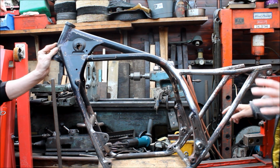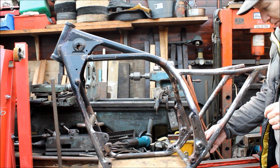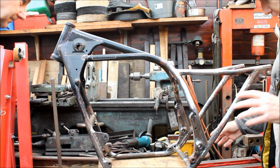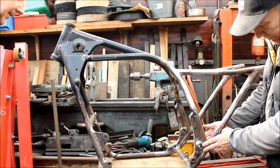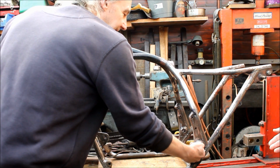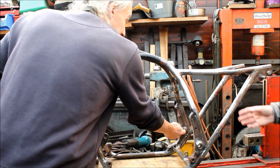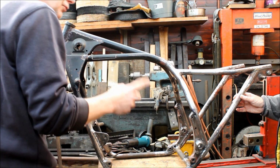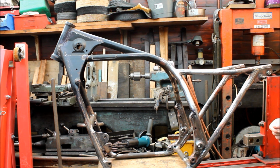Also, just a reminder, we've now gone up to 20mm for the swing arm spindle. We saw you preparing these last time around, or I think in the previous but one video. It's very tight in there because when it's been welded, you have to tap it in with a copper mallet, which is probably the best thing you can get. Once it's shimmed, it keeps it absolutely rigid.